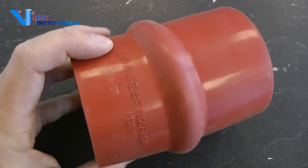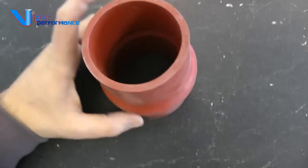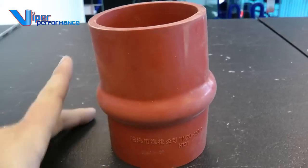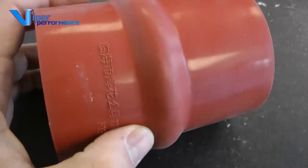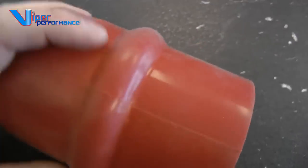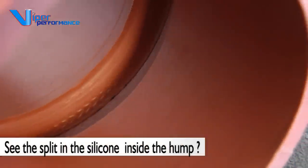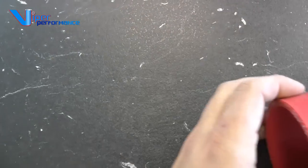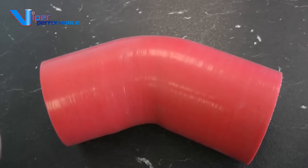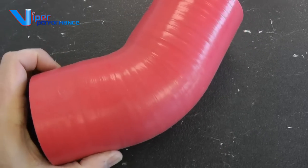This has got to be one of the most interesting examples I've seen lately. The hose was sold as a straight hose — in fact, it is completely bent. So if you wanted to straighten that up and fit it, you'd stress the hose immediately. Again, it is moulded here as a two-part mould, not the best for life expectancy. It's very cheap to make and the moulding is not good — this is a very weak spot on the product and is likely to last not very long at all. Of course this is half the price of a Viper hose, but how long would it last? I bought this from a very popular seller on eBay in the UK, and these guys are selling generic silicone hoses claimed to be high quality.